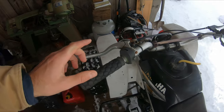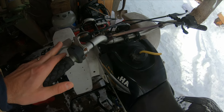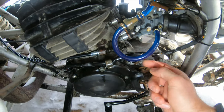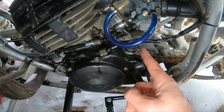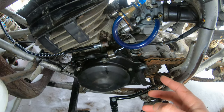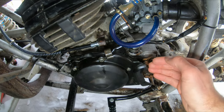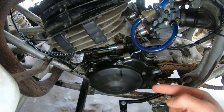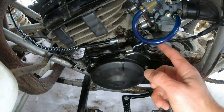The other thing I need to address - I've got to address the clutch. After riding around for a while, the clutch armature stopped working. It's just not returning. Underneath here, within the armature, it was pretty beat up down in the case. I'm wondering if the push rod has been able to slip past the paddle and the armature has kind of slipped off the side because the inside of the case was really beat up. So I've got to pull the motor, go one more time, and take another look at this. It's possible I may need to get in here with some high temp JB Weld to tighten up the tolerances if I find that the clutch push rod did slip past the armature, because all this is moving, but I can pull that clutch and it doesn't disengage. You start it in neutral and you can shift through all the gears without clutching, but you can't clutch - you're just going to stall out.